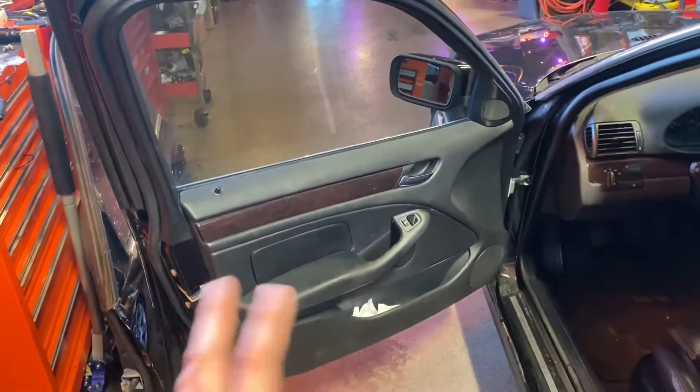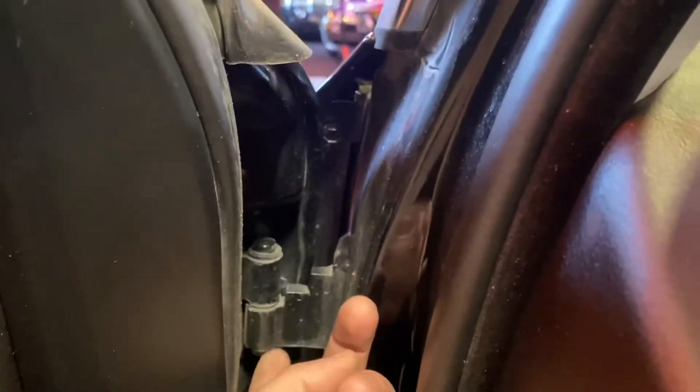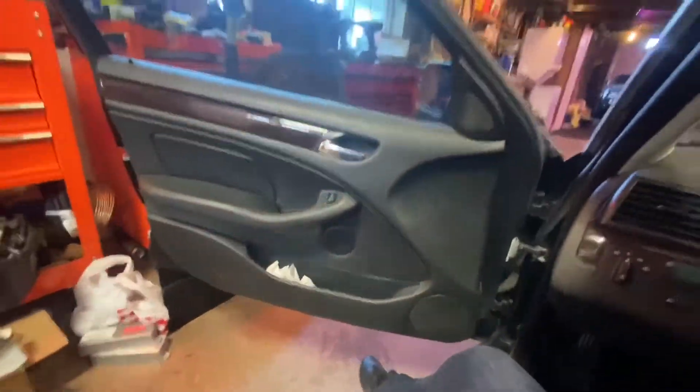Really all I should need to do is pull the door panel off, pull the bag out, disconnect the mirror, then the door brake — you just pull back this rubber piece right here. E46s were nice — there's a single E-Torx bolt for the door brake, and then a coarse screw that fastens the harness into the car. Then if the car hasn't been messed with, there are two 10 millimeter bolts on the bottom of both hinges and you can just lift the whole thing straight off and up. Final adjustments are done with the 13 mils.